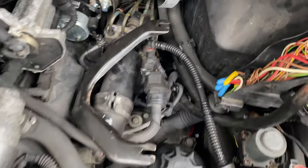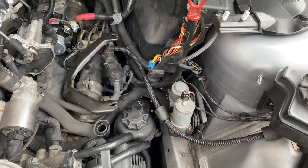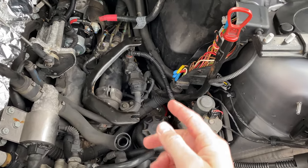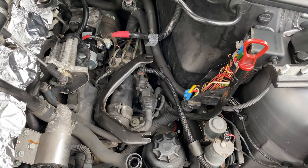But we also need to potentially modify the dipstick. You can just about see it down there. So the problem is when you put the CSL airbox on there, you have to bend this away from where it was about here on the plenum, but really it needs to be back here, looking at the carbon airbox mounting point. So yeah, that's going to be today's first jobs.